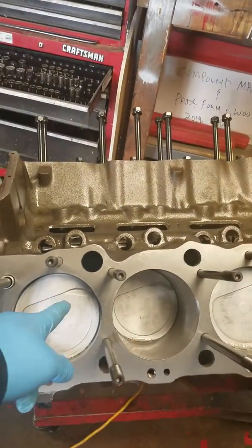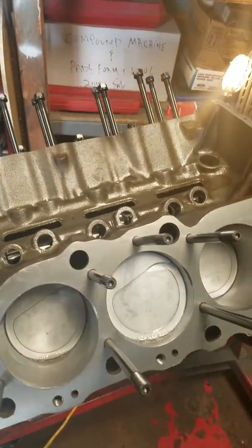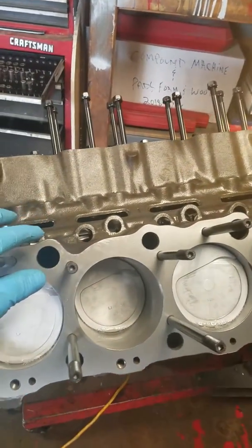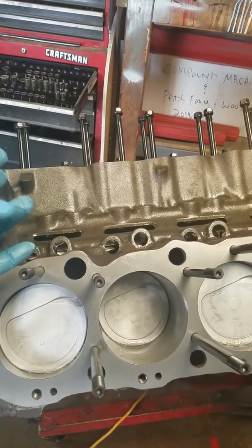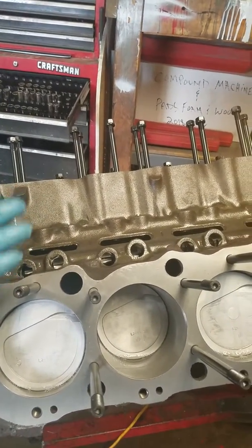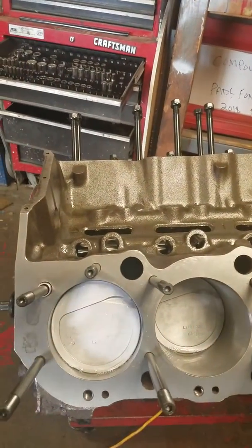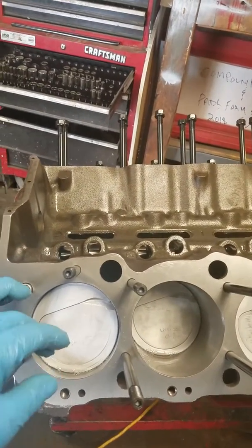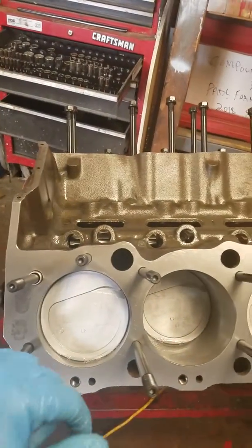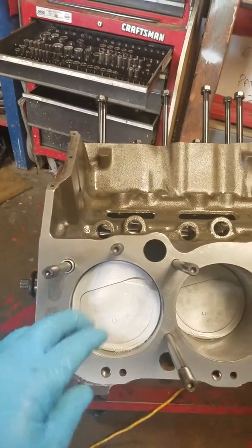Everybody says that when you do piston to valve clearance, use a solid lifter, even if you're running a hydraulic roller. You put everything together, the pushrod, the rocker arm, everything. You use a solid roller, you put the clay, you turn the motor two revolutions, and you check it. Well, everybody uses a flat tappet solid lifter to do this, and that's what they say is good.